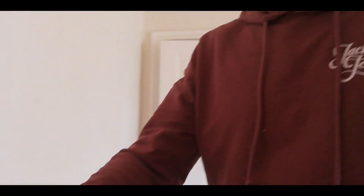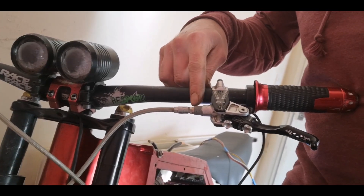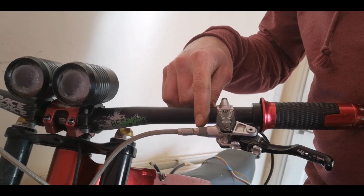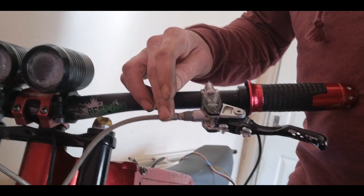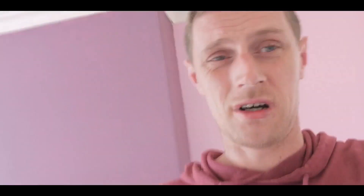I've seen some awesome levers off a motorbike that aren't that expensive — you can get them on Amazon and they look really neat. The only issue is mountain bike brakes use an M8 thread into the lever, and the motorbike ones are M10, so I'd have to change the union one way or another to make it suit. That's my issue there. Anyway, can't wait for the postman — I'm not telling you why, you'll have to wait till next week. Thanks for watching, please like and subscribe, see you next week!